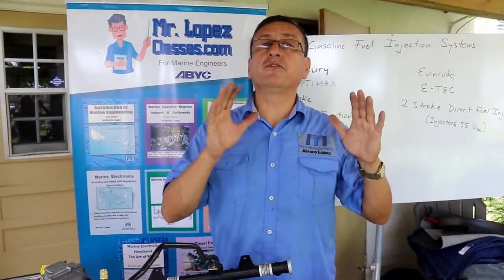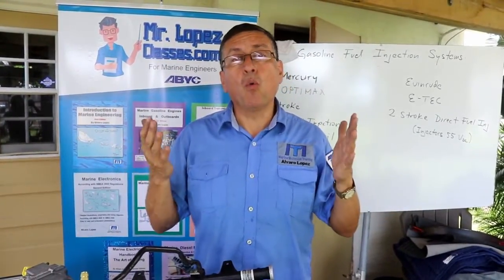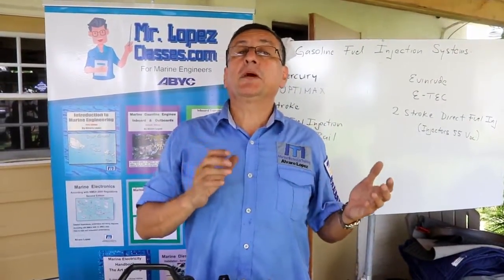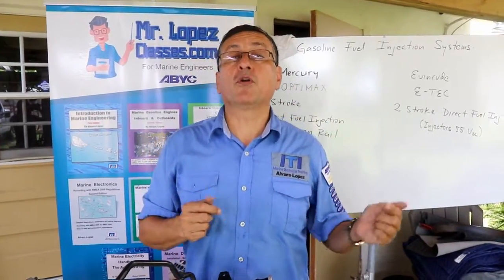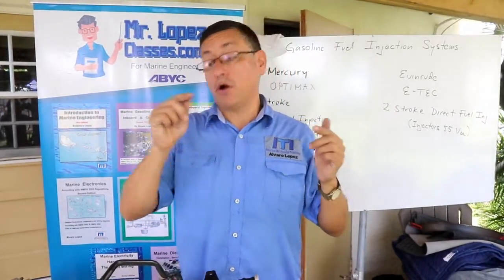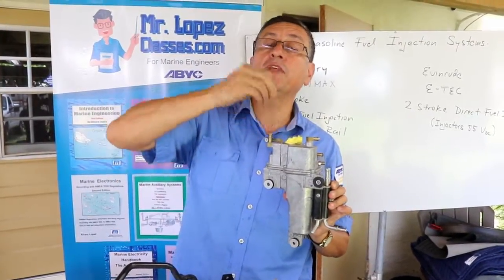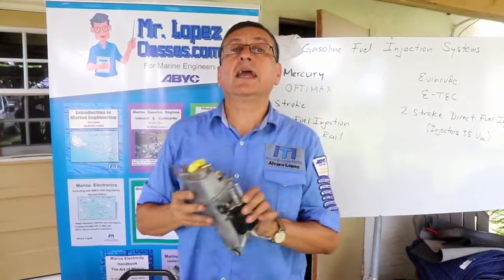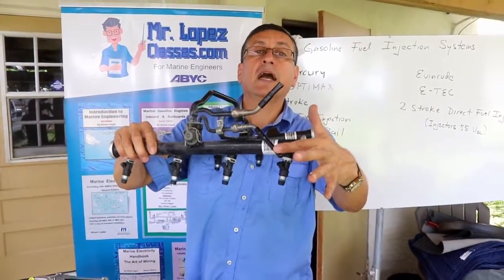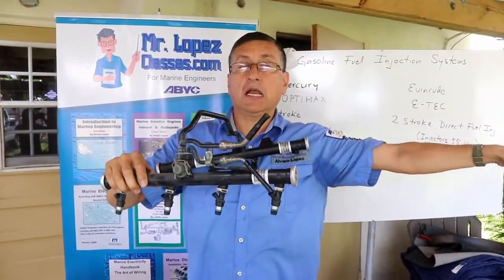You need to start in the fuel tank. Verify that the fuel in the fuel tank is clean, no water. Verify that the flow switch in the fuel tank is working properly. You need to verify that the transfer pump, lifting pump, or priming pump, the low pressure pump, is working. You need to verify that the second pump, the high pressure pump, is working properly. You check the pressure, remove the outlet, and verify that the pump is pumping and that the fuel enters the common rail. Also disconnect the return and verify that the return is coming out to the tank.